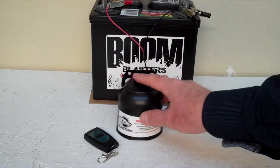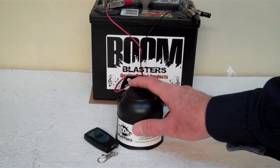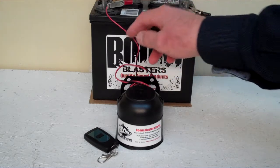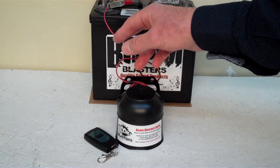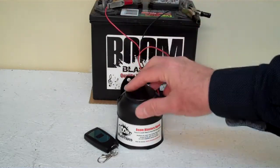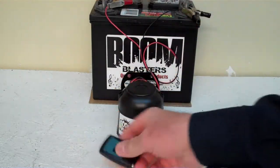We've got it facing down guys — it's a pretty loud car horn. It's easy to install: your black wire will go to a ground somewhere, it could be your battery or anywhere you have a ground, and your red wire will go to a 12-volt power source — it could be your battery or fuse, wherever you have a 12-volt power source. So this is our Kalmoo wireless car horn.